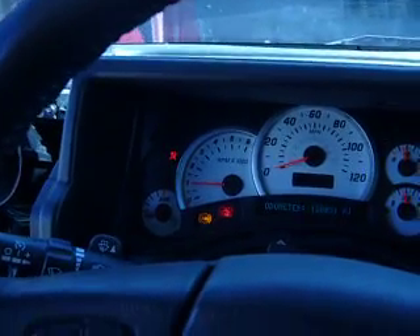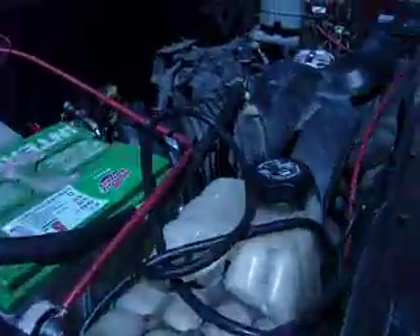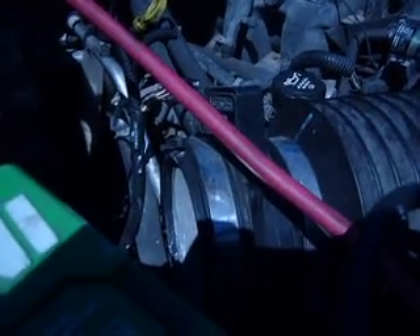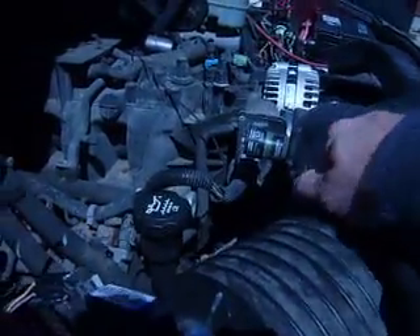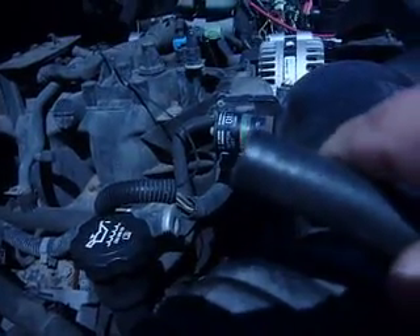As far as the drivability issues, what I have done is - I'll show you as I gear up the truck - I removed the air intake right there, cleaned that, and that took care of the stalling and the rough idling. I also cleaned the MAF sensor, and I have hooked back up the hydrogen, as you can see, because I've got to get this thing tested now - and there's some hydrogen coming out of there.